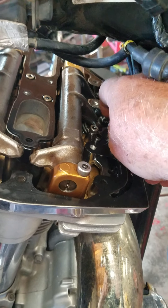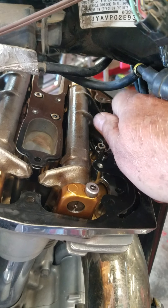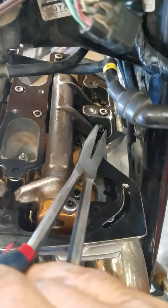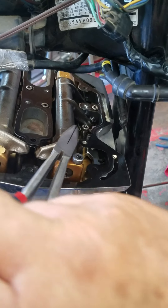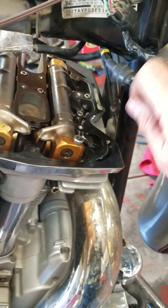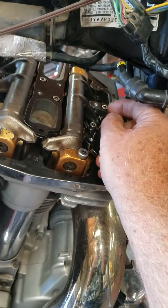Loosen it up by fingers with the nut off. Tighten it down by fingers until there's resistance. Then, to be sure, I take these needle nose pliers, stick them on the adjuster without the nut on it, and hold a certain pressure on the needle nose to try to tighten it. I hold a pressure to where it'll loosen, but then when I go to tighten it, the jaws slip on my pliers. It will loosen, but then it slips. That tells me I'm loosening and then getting down to zero lash. It takes more torque then, so my pliers spin by just holding a certain pressure. That's how I know for sure I'm not hung up on a little dart on the thread or something.